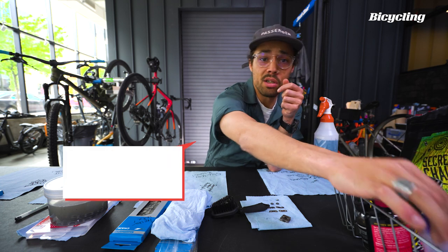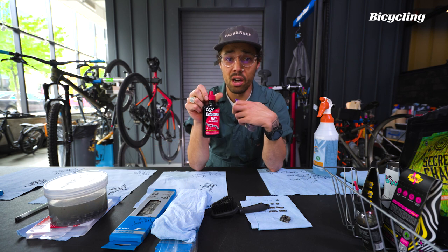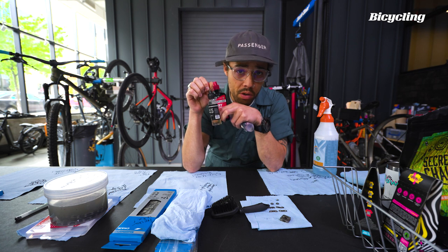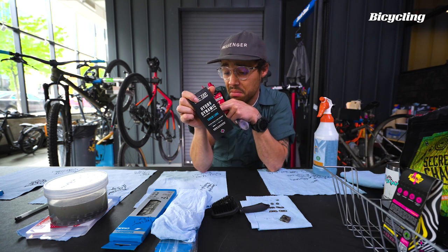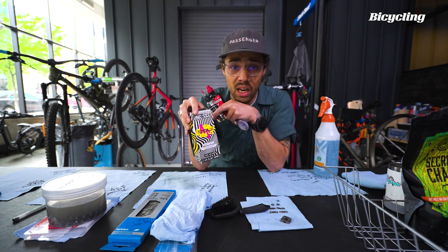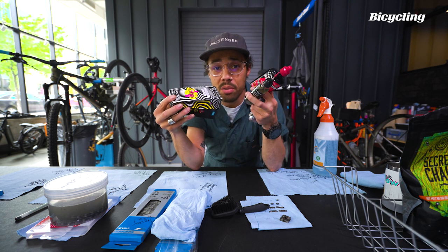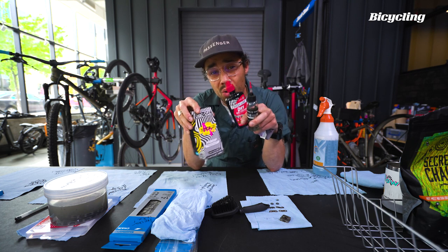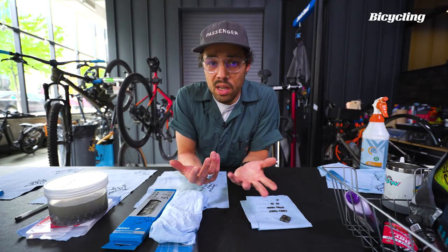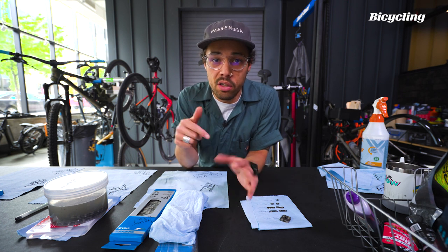Hopefully you can put some lube on it next. I've got one lube that's for extreme conditions, another that's specifically for dry, one that's got different additional metals in it, and some that are specific for what we're gonna talk about later. There's tons of options out there, and ultimately whatever you end up picking for whatever you ride, just make sure you hit the lube on each roller. Now that we've done the bare minimum, let's actually take it one step further — actually taking our chain off our bike and getting into the nooks and crannies of it.